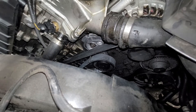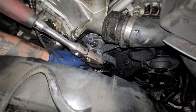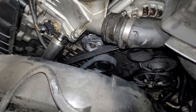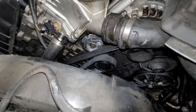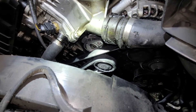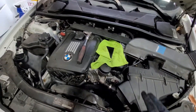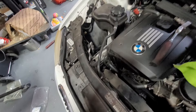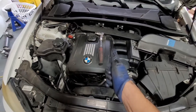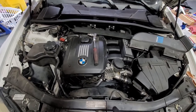So now at this point we're going to release our tension — go clockwise and then pull out the pin. It is going to be a lot of tension on there. So there we have it. Double check, make sure everything's in its grooves. If not, you're going to have an issue with the belt. At this point you're pretty much done. I got to put on a new oil filter, which I already got right now, so I'm going to go ahead and slap that on. But pretty much that's how you put on the belt. If this video helped you out, give it a thumbs up, comment down below if you have any questions, and hit that subscribe button for more upcoming videos. Thanks for watching.